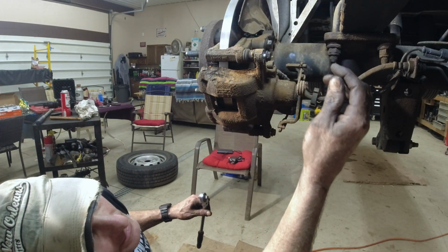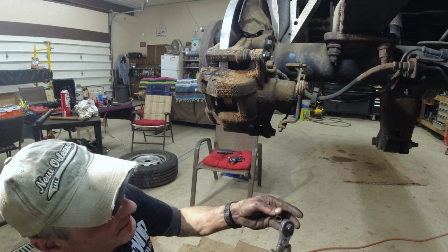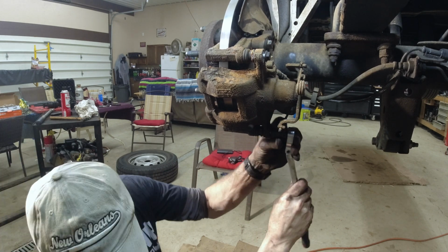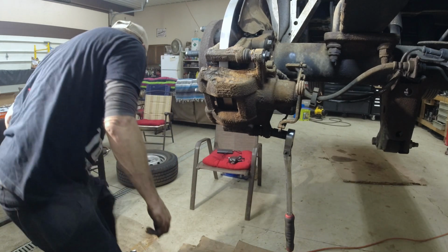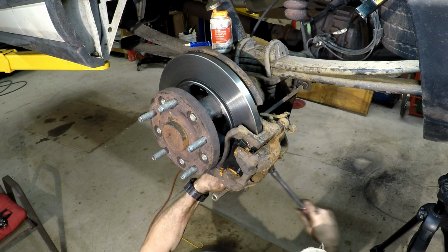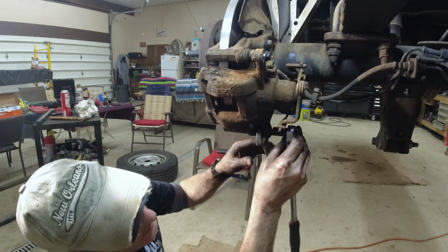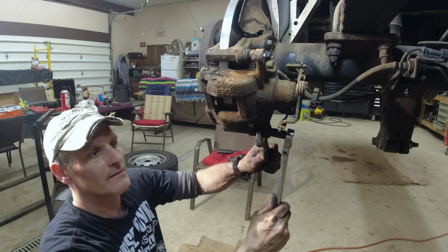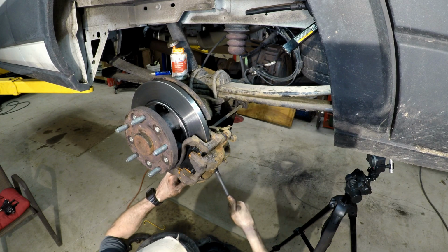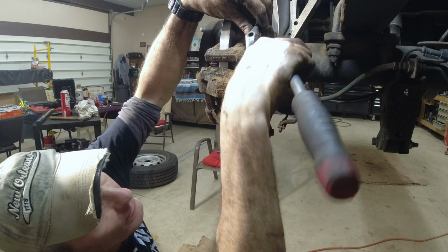These are supposed to be, I think, the 22 foot-pounds. I'm just gonna give them a little snugging. That's it. Just gotta do one of these numbers. You're gonna have to hold that though. Keep from spinning. Your adjustable out. 22 isn't much. Okay? So you're just gonna go like this. Just give it, oops. Don't do that. Just like that. All right, when you're sitting up here, hold on to a little flat spot. Don't mess your rubber up.